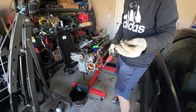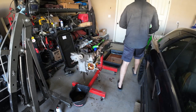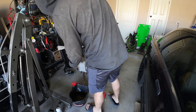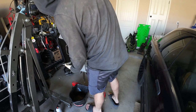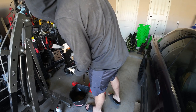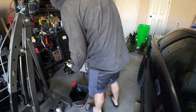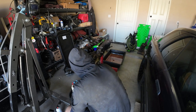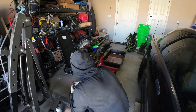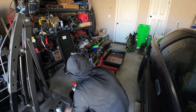There is the timing cover, and the oil pump gear just fell out. Now we can take this guy off. This timing chain can come off and get tossed — we are replacing that. Here's the little crank sprocket, here's the drive for the oil pump. It's interesting. This gasket's trash.